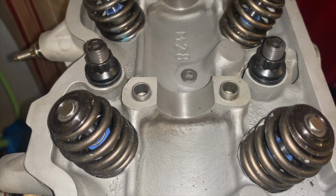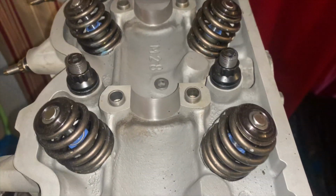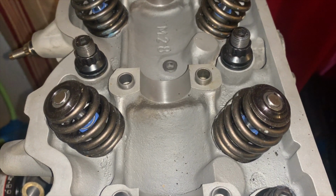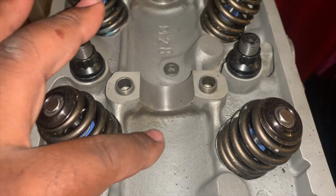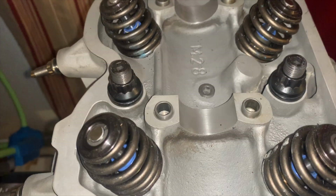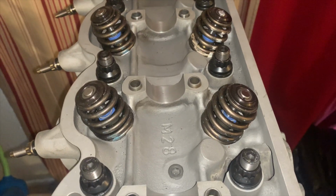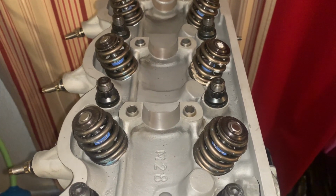And the cam we're going to be putting in is a 274 cam, which should work perfect for this application. 274 is measured in duration, not lift, because if you go too high, which you really can't, it'll touch this bottom part. And I don't believe we would be able to cut into this without jumping into a water port or weakening the head overall. So these cams are all done by duration, not by lift. So let's get this prepared and we'll take it from there.